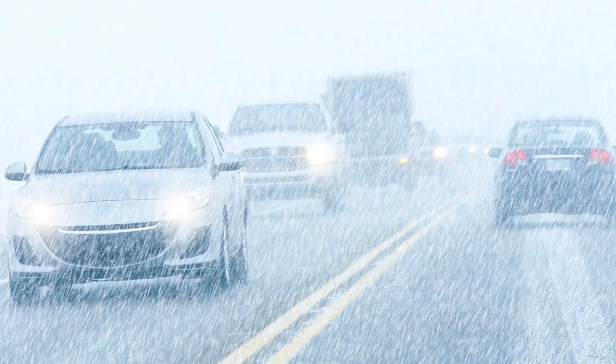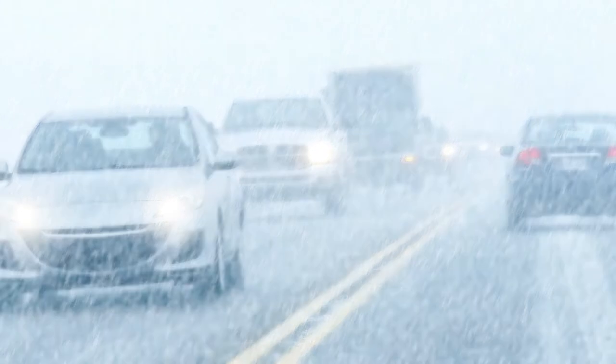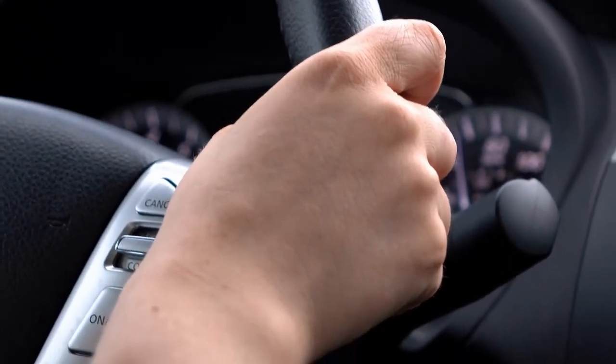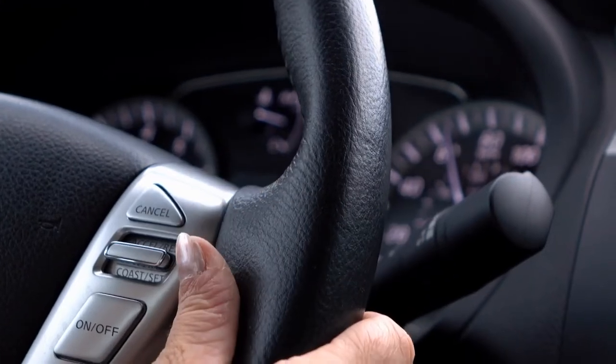So what would cause a steering knuckle to fail prematurely? Most commonly, it's due to damage from collisions, potholes, or curb strikes, but it also could be the result of rust and corrosion, especially in parts of the country that experience harsh winter weather. If you have a customer with a bad steering knuckle, they might complain that the vehicle shakes or pulls to one side while driving, or they might have noticed uneven tire wear. As discussed in a previous video, replacing a gen-one press-in bearing is a notoriously labor-intensive job and runs the risk of damaging the existing steering knuckle during the process of removing the bearing.